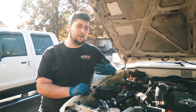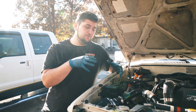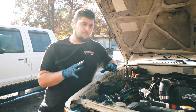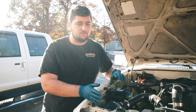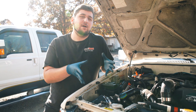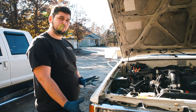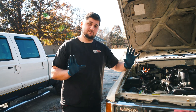Now we're going to move on to my intercooler setup. I did a lot of research on these cars trying to figure out what's going to be the easiest way. I've seen a lot of different ways on YouTube of how to do your intercooler — there are plenty of different ways. I've seen some really clean setups with a lot of fabrication work, but I really didn't want to do all that work. I was trying to make this swap as quick and easy as possible, and I really didn't want to do a lot of cutting to my front end or grille to fit a front-mounted intercooler. So I took notes from the Volkswagen intercooler system — on the car it's actually mounted up into the fender well behind the front bumper.